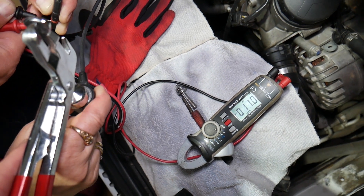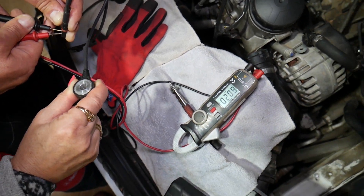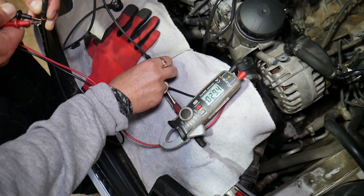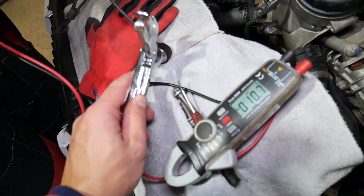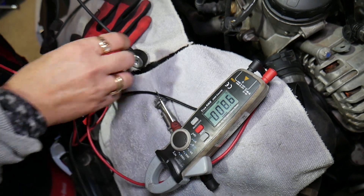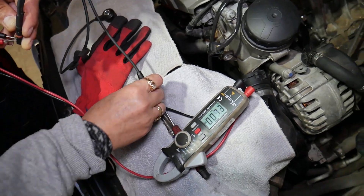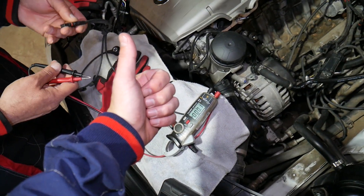The harder I hit it, the more voltage it produces — that's a good sensor. If the sensor is not moving at all, if it's not changing anything, that's definitely not a good sensor. Even if it's not on the engine, if you tap on it, it should change. You can see 60, 70 again — definitely a good sensor here. Hopefully the video was helpful. Thank you for watching, please subscribe to our channel for more help, and see you guys next time.